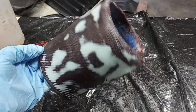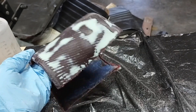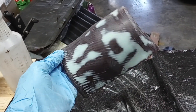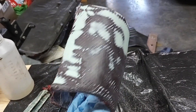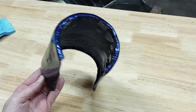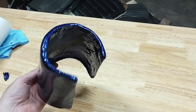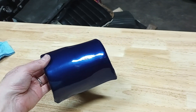Here's a look at our piece as we're closing in on the finish line. I've got it already cut, everything is sanded, I have one layer of filler on it, and it's sanded out through 1500 grit. Now I'm going to go ahead and paint a black base coat on this just to cover everything up, then re-sand it out to 1500 grit, and then we'll go ahead and put the vinyl on it. And here's going to be our finished product — carbon fiber all done, all sanded, painted, re-sanded, cleaned with alcohol, and then wrapped. All those hours of work just for this little piece — let's go ahead and throw it on the car.